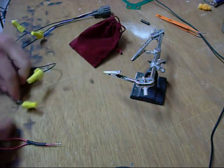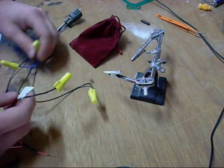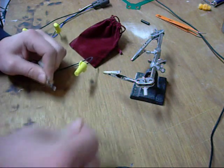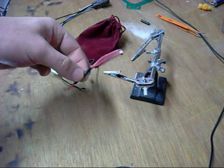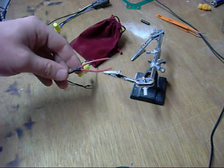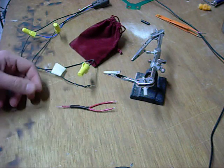We're back in the garage now. We've got our connector squid here with the two heater wires — the one that we marked is 12 volts so we still know which one that is. And then there's a signal, blue, and then the ground reference, white. We're going to start with the 12 volt wire. I've got these little wishbones that I made — basically three pieces of wire, a piece of shrink wrap, and soldered together in the middle. This will allow us to break out the 12 volt connection to power the simulator and to feed to the heater, so the 12 volt source can double for both. You don't have to run a line to your accessory or to your battery — this makes it a convenient, one-shot installation.